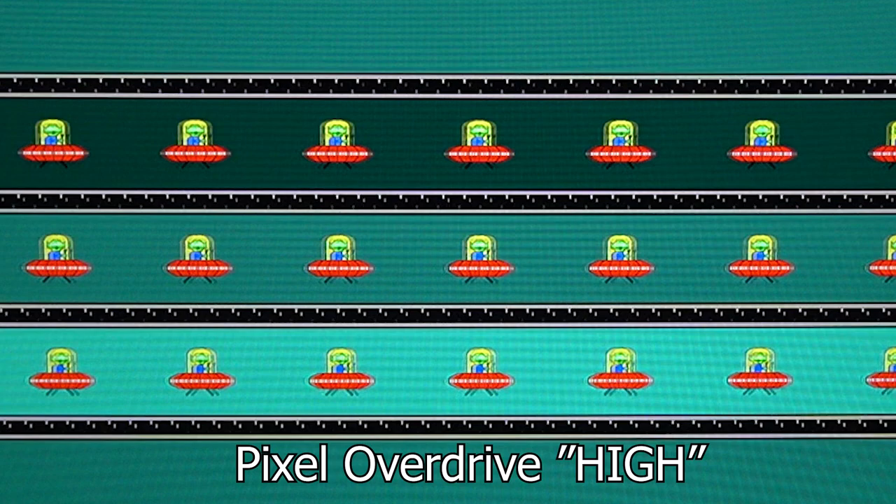With high pixel overdrive, it's actually overshooting the image, but just by a bit. The middle frame rate row actually has two full UFO images — you can see it on the feet. And the bottom shows nothing but ghosting because it's overdriving faster than it can actually refresh and turn off the previous pixel set. I tried to find something better that would give more confidence in the high setting, but I didn't find anything that was better.